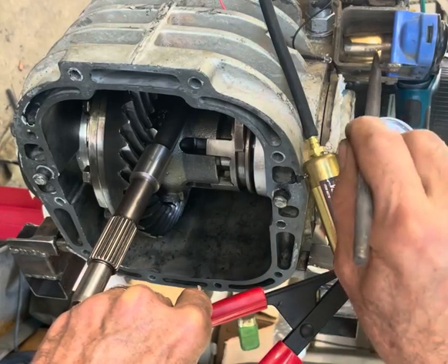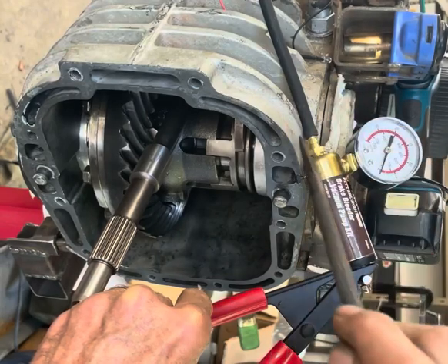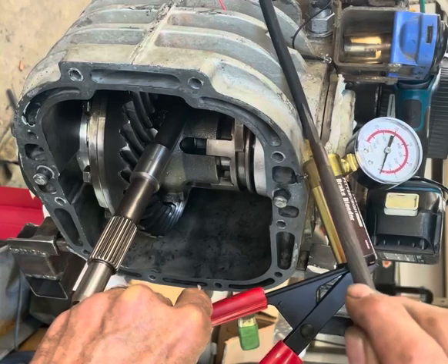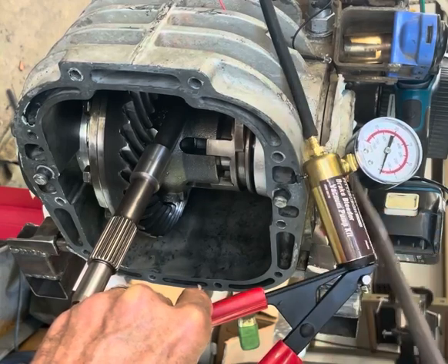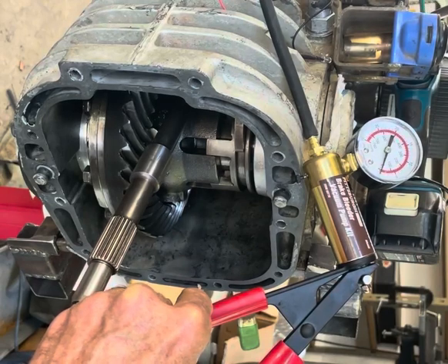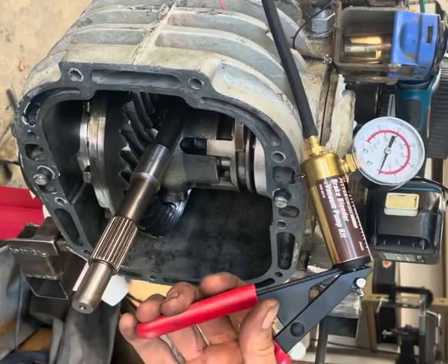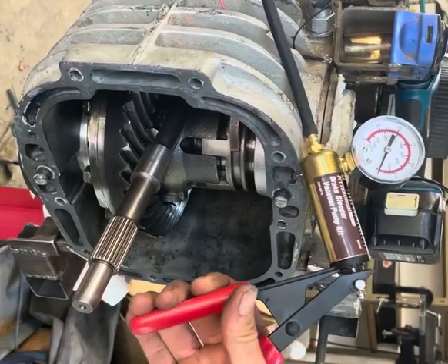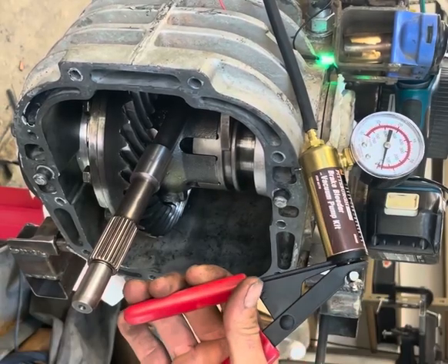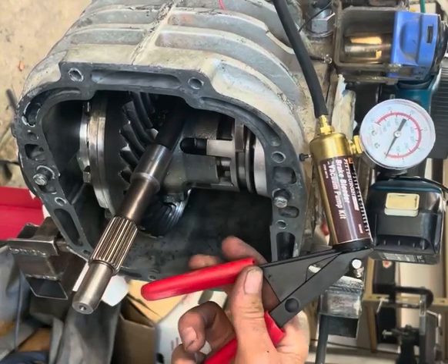You can watch the actuator here push down on the rod. This is the vacuum hose and the vacuum pump, and it goes around to the inboard nipple on the vacuum actuator. There it's locked, and there it's unlocked.